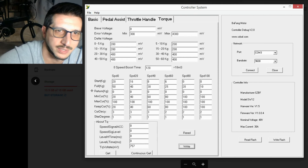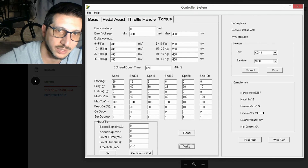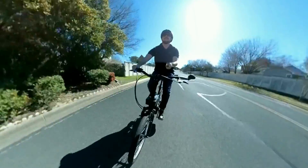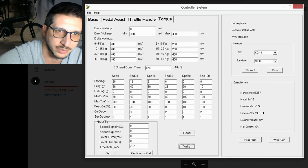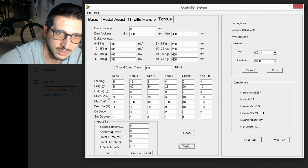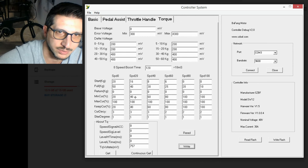The Return kg I believe is triggered if you're ghost pedaling while cruising, or if you stop pedaling and coast for a bit and then start pedaling again — that will most likely trigger the Return kg, which then gives you the Keep Current. The Keep Current has to be equal to or less than the minimum current. I set the Keep Current to match the minimum current, and the maximum current percentage is set to 100 across the board to give me the maximum power the PAS is set to.